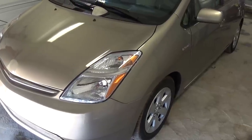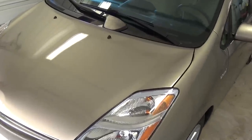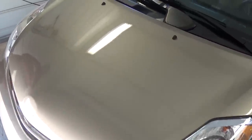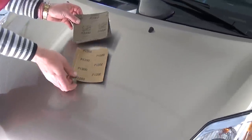Welcome back to our channel. Today we're going to show you how to fix orange peel after you paint a body panel. We have dust in the paint on this one — from this angle it looks pretty good, we painted it the other day, but you can see there is a little bit of orange peel in the light and there is some dust. We're going to wet sand it and buff it with three different compounds to make it smooth like glass.